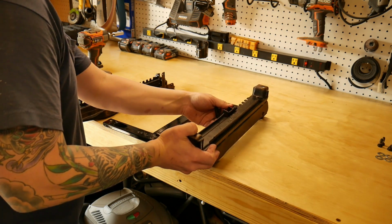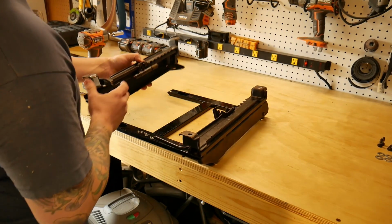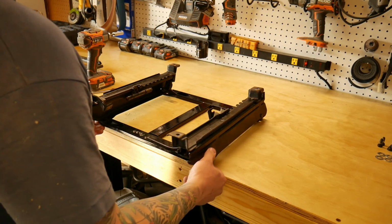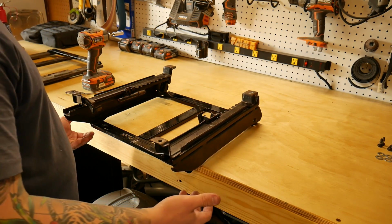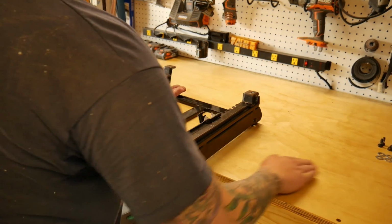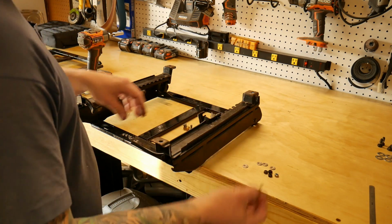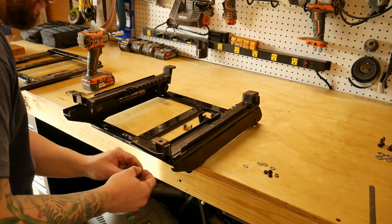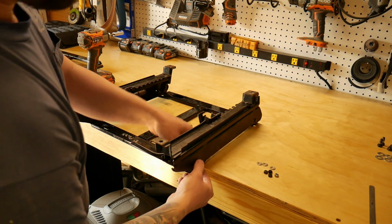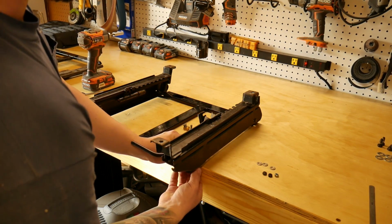You'll put this side with the bar on my orientation right-hand side, and then the side without the bar on the left-hand side. Bring it a little bit to the edge so you can get access. Take your 20 millimeter long M6 by 1.0 thread pitch bolts. Push it through to the bottom. Put your washer and put your nut on the end.